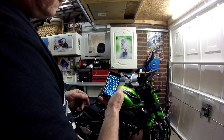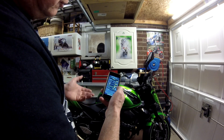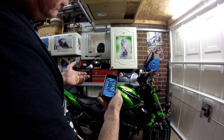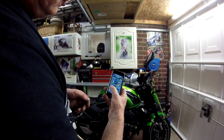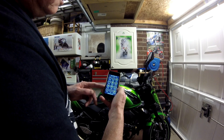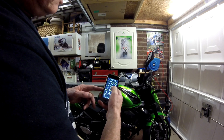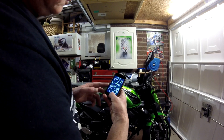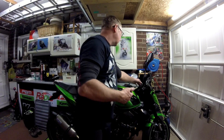You're not going to rev it at 15,000 — that's revving the nuts off it. So if you're going to do it, 8000 at the most. You want to look after your bike; you don't want to blow the engine up. The cutoff is 100 milliseconds, that's just standard as it is. So you've got the revs per minute, the sensor, the cutoff times — and that's about it. It's only those three really. That seems to be done — understood.